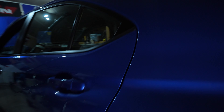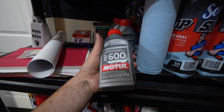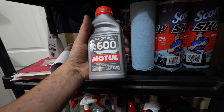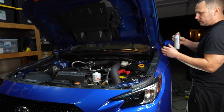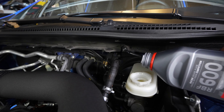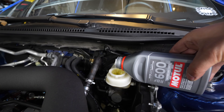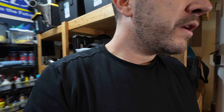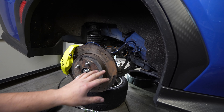What we're going to do is fill the brake reservoir up with brake fluid and then bleed everything. I bought some Motul RBF 600 - it's the racing brake fluid, DOT 4, which will work in the WRX. Let's go ahead and put some brake fluid in. Be extremely careful not to spill any of this - you may want to use a funnel because it'll eat away at your paint.